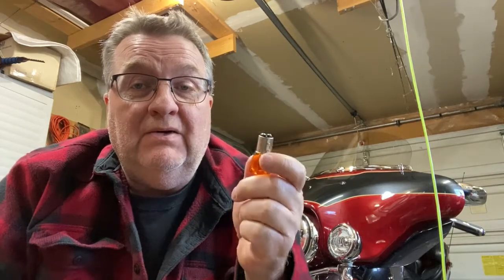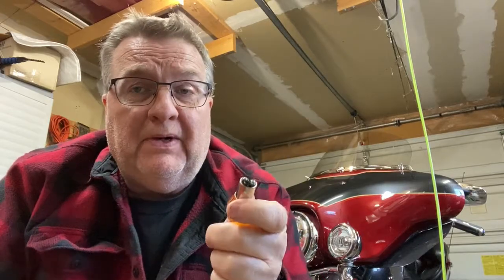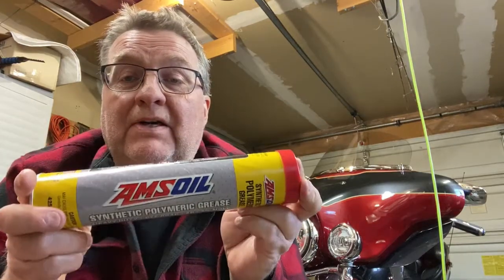That's the only point of today's video: if you're going to use dielectric grease on LED bulbs, please be super conservative. And if you don't have it, don't run out and buy it — it's not the cheapest thing. Just use whatever grease you happen to have handy, grease those bulbs, stuff them in the sockets, and it'll prevent corrosion. They'll work great for a real long time.